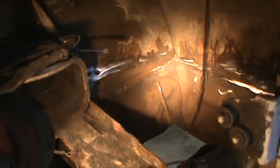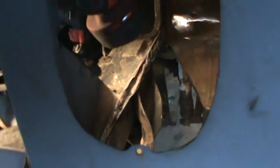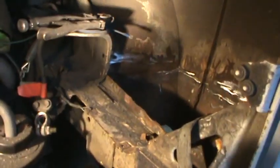I just kind of left the lower lip alone and ground it flush to the wall. I figure I'd do more damage than good trying to remove any of that. Right there is the seam for that lower piece, so I'll use that as my guide for how far down I drop the pan. Instead of having the lip bend down, I'm going to have it bend up all the way around. There's bondo showing through right there where a side marker light is supposed to be attached, and another hole for a bracket for a bumper shield. I'm going to open them back up with a drill while I can get in there. I just ground it flat — there's a difference between being pretty and being strong, and that one wins because no one's ever going to see it.